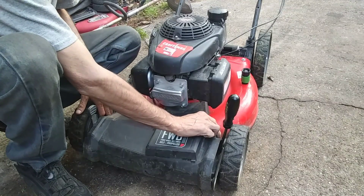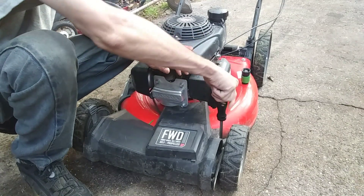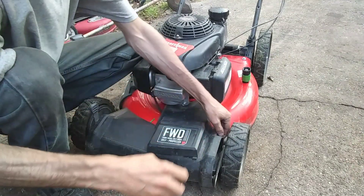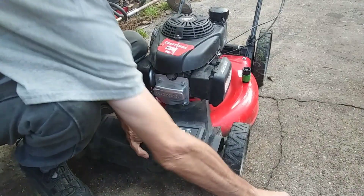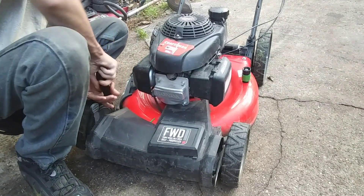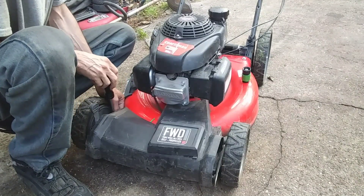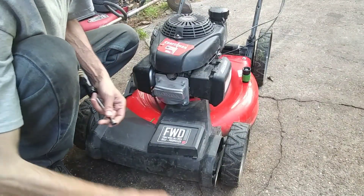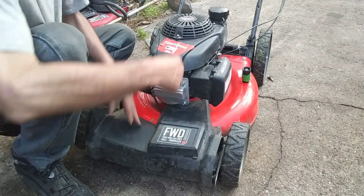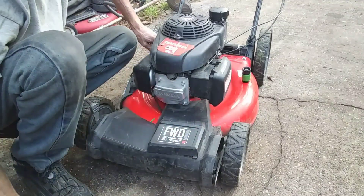First thing we're going to do — there are two 10mm or 3/8 bolts on each side of this cover. This has got the Honda GCV 160 engine on it, a good little engine for the homeowner, really good for anything. These are all plastic or threaded plastic screws. The only thing that can be confusing is there are about six screws underneath that you have to take off to get this cover off. I hate to flip the mower up on its side, but if you're going to have to, make sure you flip it with the air filter side up, make sure the gas tank's tight, and that the oil cap is tight when you flip it over.